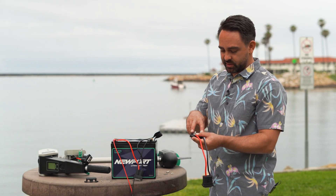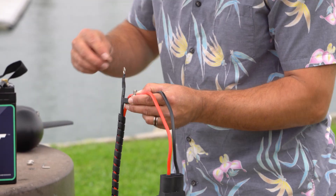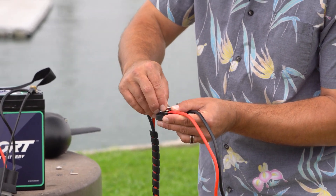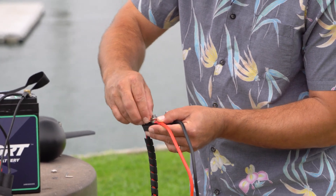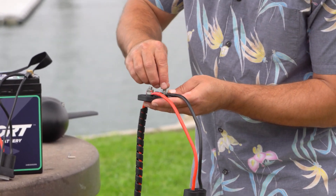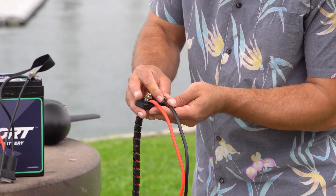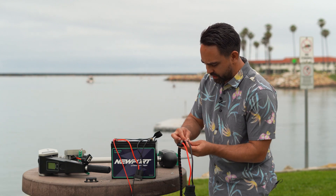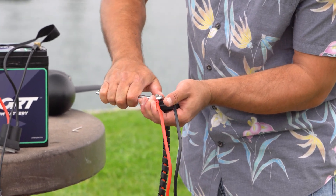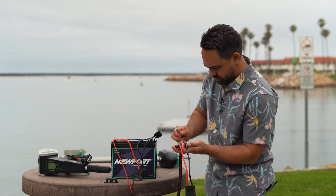As always when you're setting up this junction box, you want good metal contact. You want that initial washer on the bottom with the terminal ring stacked on top for good metal contact, and then you're going to match red to red. I'm going to complete the installation one side at a time. I'm going to loosely assemble this nut onto that bolt first, then tighten it down to ensure that these cables are in a straight line. That way when you put the cap back on, the cables will pass through the little opening in the cap. I'm going to use the size 14 wrench and stabilize these cables so they stay in a nice straight line as I'm tightening them down.